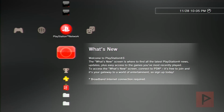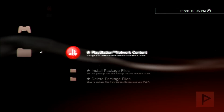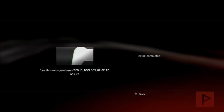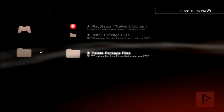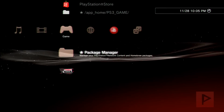All right, congratulations. You are now on official Rebug. How do you know that? Because now we have Package Manager. So you can go here, you can go to the system storage, install the Rebug Toolbox, and then you can follow my other video tutorials in the past that I've done on how to configure Rebug Toolbox and how to install additional package files.